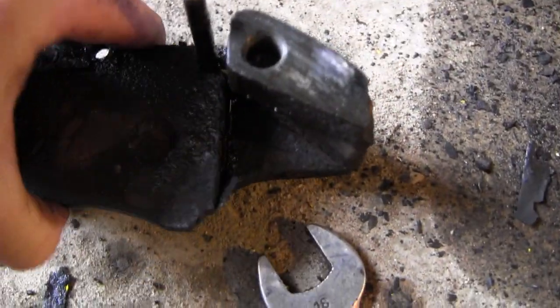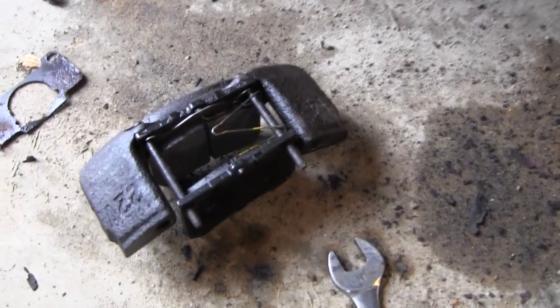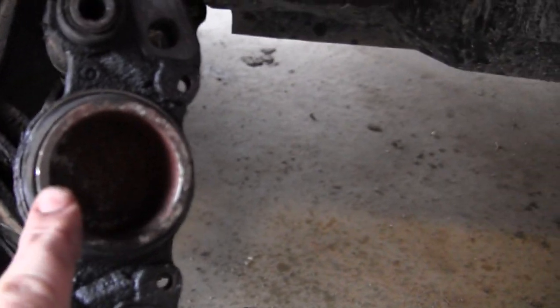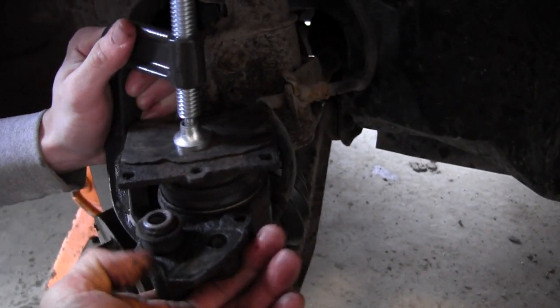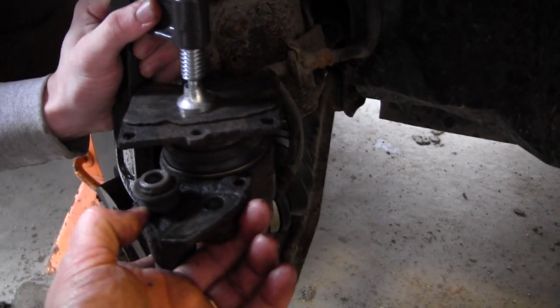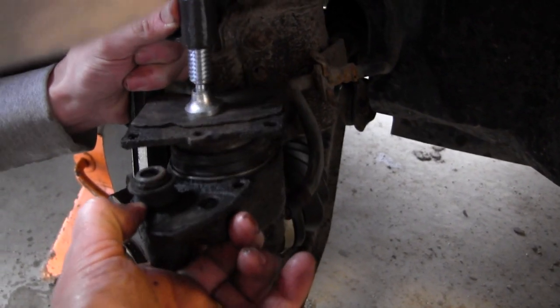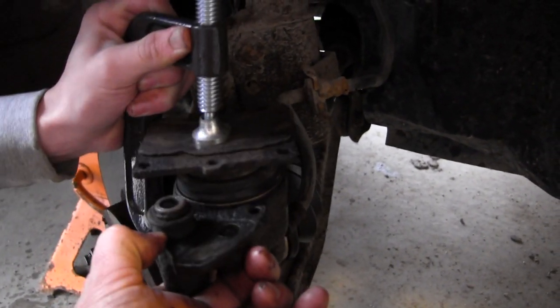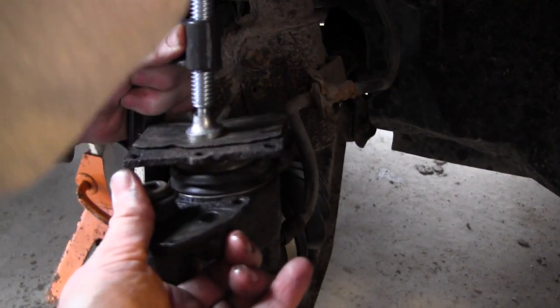Now I'm going to pull the inner pad out — we've already got the outer pad off. With the brake pads installed with the clips, we have to work on this caliper: we've got to push the piston back in, and we use a big C-clamp for that. Using one of the old brake pad metal backings and the C-clamp, you just start cranking it down until you get that piston pushed back in. Sometimes you have to open up your reservoir — if you had filled it up recently, it might try to squirt out, so watch out for that.